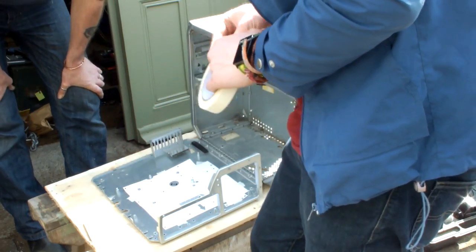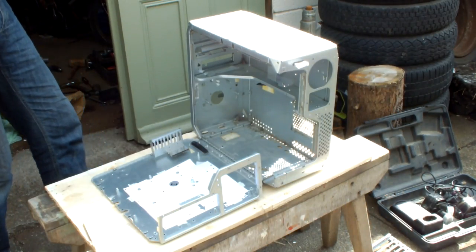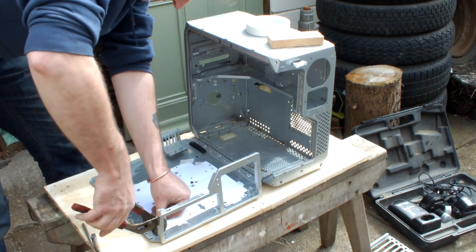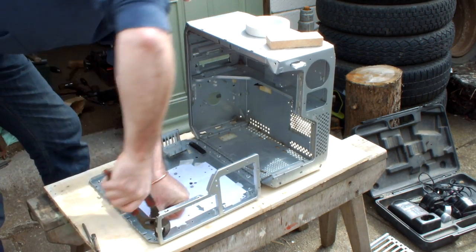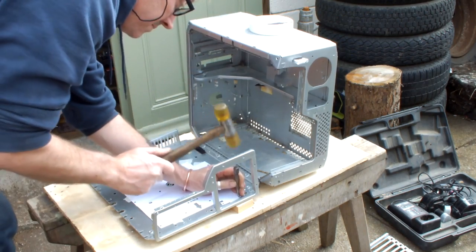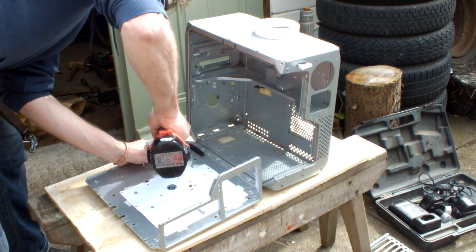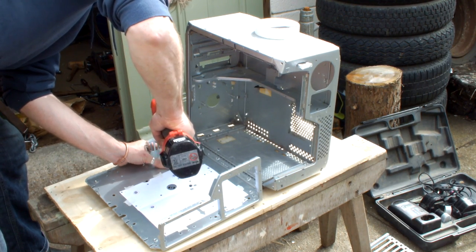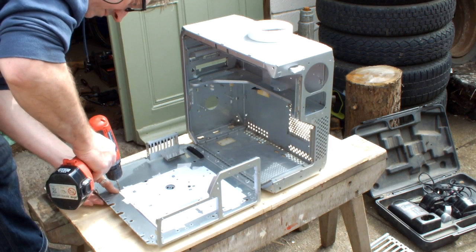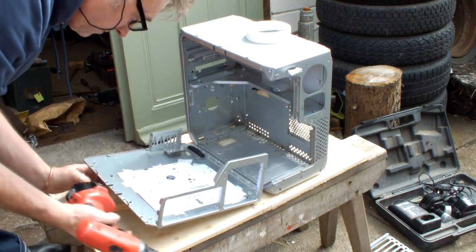The template does put the MATX motherboard quite central to the door, with a nice bit of space above and below. Originally I did not know that you had to remove all of the G4 standoffs, but as soon as we put the guide down it showed us that you do. You can literally just yank them out, but it's important to make sure the door is flat after. All we really need to do with this tray is drill our new motherboard standoff holes for the MATX layout. The guide showed us exactly where to drill - you make eight holes to screw your standoffs in, and your board will hopefully line up against the backplates.